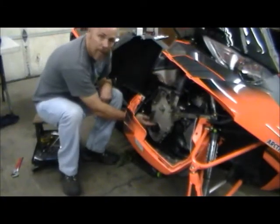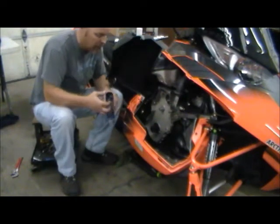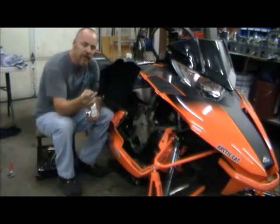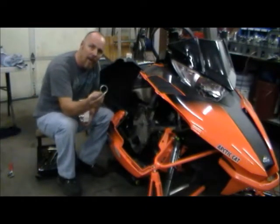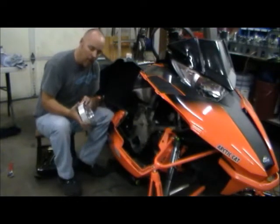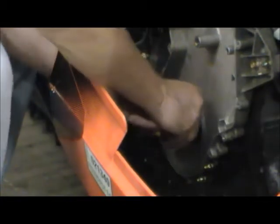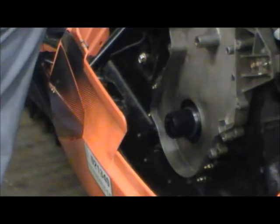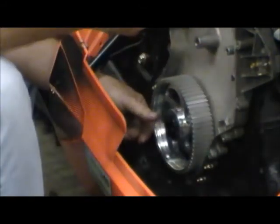We cleaned out the whole case, took some carburetor cleaner, blew out this bearing really good with some compressed air. Now just pack it real tight with grease with your finger. This is the grease retaining ring that's supplied in your kit — that'll just snap into your chain case. Once you get that in, this little spacer will slide onto your shaft. Then your bottom pulley goes on. This counterbored side with the chamfer on it goes on the shaft first, so the seal goes on first, then the aluminum spacer, then your pulley, counterbore in. Now all you need is your snap ring installed.